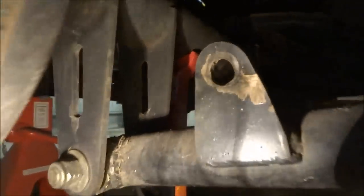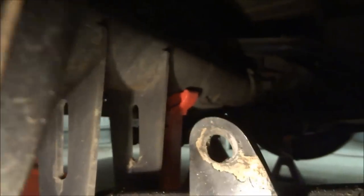What I mean by that is, see how these mounts are on the bottom of the rear end? And if you look close up in here, there's a mount on the top of the rear end also with this pipe. That keeps the rear end from what they call rolling, so it won't spin on you. That's one of the basics. You can have a triangulated 3-link or a 4-link or a parallel 3-link. There's a bunch of different setups. It depends what you want to do.